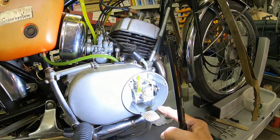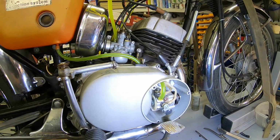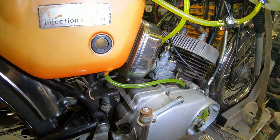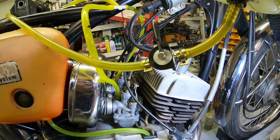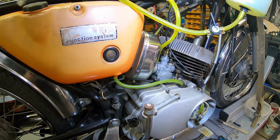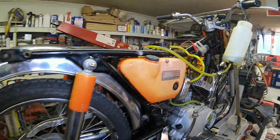But like I say, yesterday when I pulled this cover off and saw that JB Weld repair on the pump, I thought, oh my. I thought, well, I'll just hook the oil tank back up and I'll put premix too. But it's destroyed, it's gone. Actually the top end sounds okay. I'm not hearing a lot there, and when I pulled the head off to fix the spark plug, I did notice that this cylinder looked okay. I don't know what the clearance is or anything like that, but it looked okay in there. So it's probably the major damage is to the bottom end. Of course, that's the hardest, most expensive part to repair. But that's just the way it goes sometimes.